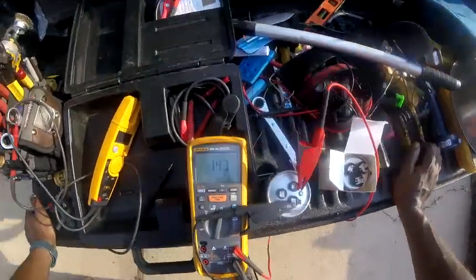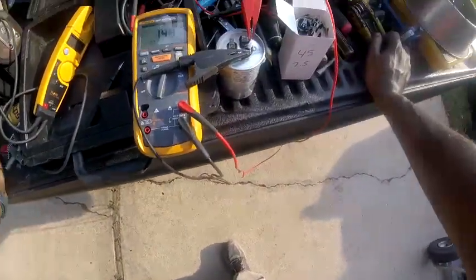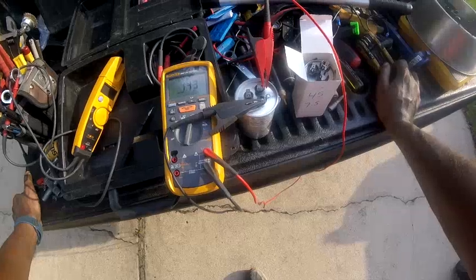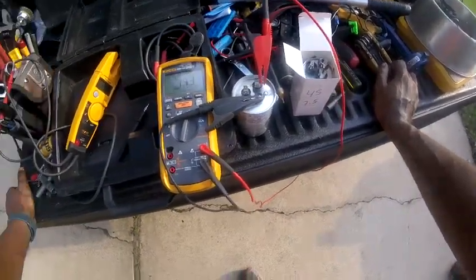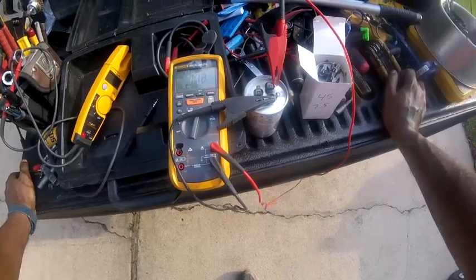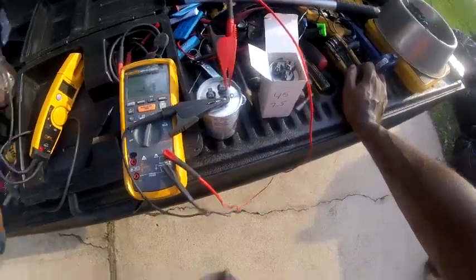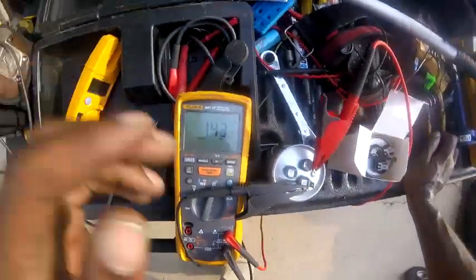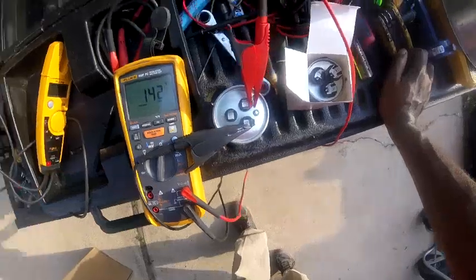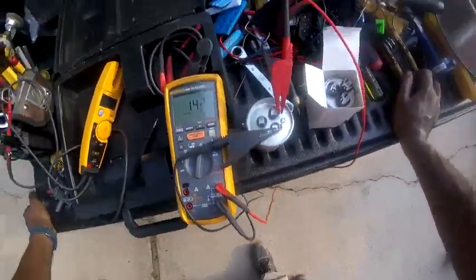That was a tricky new one on me. It was a 1992 unit and I almost told the guy it had run its course because the compressor wasn't circulating properly. But I ohmed out the compressor, everything checked good, checked the insulation — everything checked out. Someone told me to go ahead and check the capacitor, and that's what I found.